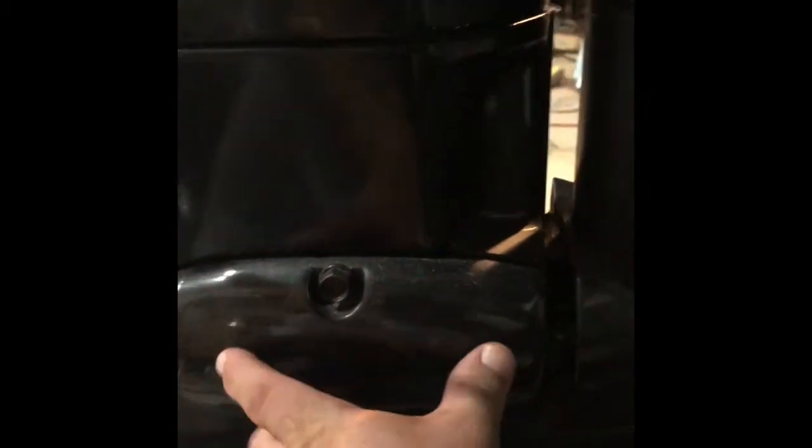So you have to take off these 3 bolts on each side, and then there's a bolt that goes through here, and it's got a nut in here, and there's a big rubber washer in here. So these 2 bolts, one on each side, come off, and then you have to take the foot off, which is not bad at all. So that removes the shift linkage out of this tube, and then that takes the drive shaft out.